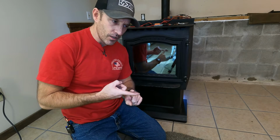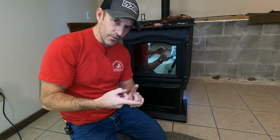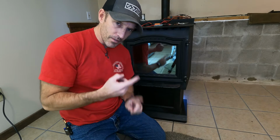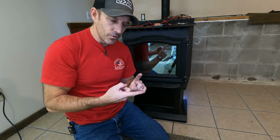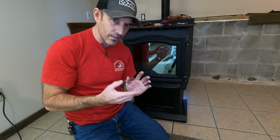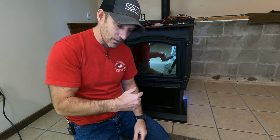And some of the stuff I'm talking about, I'll try to find some of this and put it down in my description. If you need a new ESP probe or a new igniter, maybe even a new control board. Most likely you just need to clean your exhaust and clean your ESP probe. So if you want to see that, watch my end of the season cleaning. And if you just want to see how to clean the exhaust, you can go all the way to the end of that video. And that's how I clean my exhaust out.